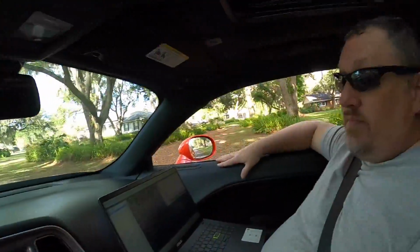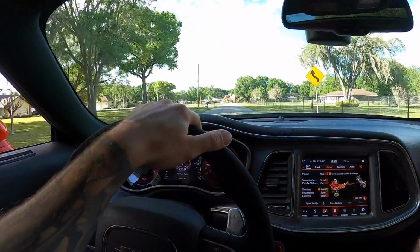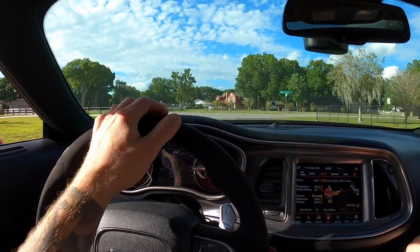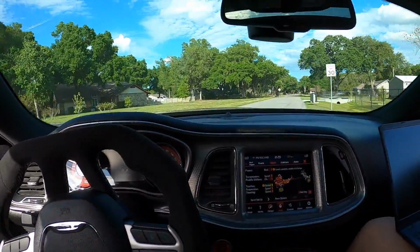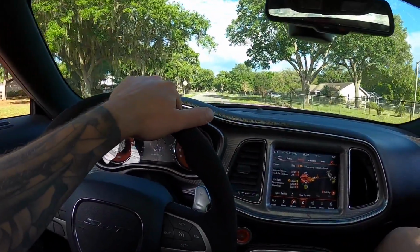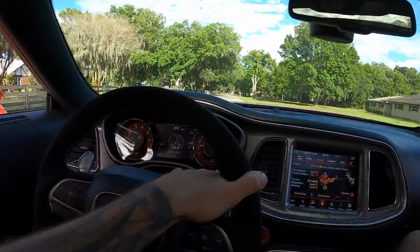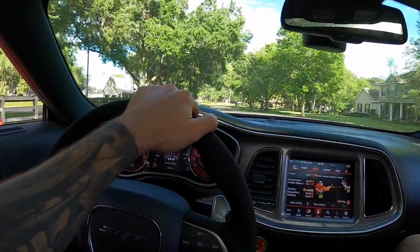What do you think? First impressions? It's got the Hot Boy tune. Good to go. That's all we need, a little Hot Boy tune here and there. Right to Bradenton. I really want to fix that sensor, but I wonder if it's in the hub itself. Could be the hub, or probably the next easiest thing to do is to check continuity from the harness. See if it's got the right continuities. Who knows if anything else got damaged back there for the wires coming forward. Maybe something got kicked up, sliced a wire.